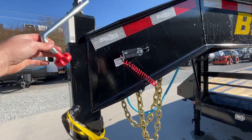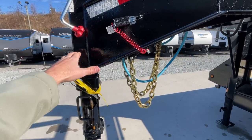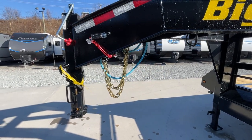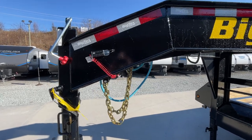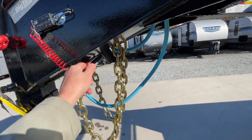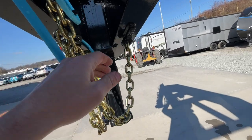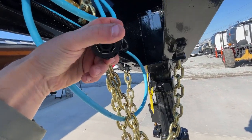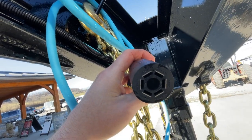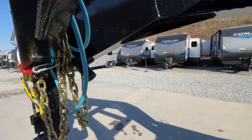The top-line jack is super slick. Unlike most where you loosen a set bolt and do pin adjustments, this has infinite adjustment — you can wind it just like a top-line jack and set it at the exact right placement. Typically on goosenecks you've got holes every four inches, doing four-inch adjustments at a clip, so this is much nicer. It also has the zip breakaway cable — these flex, unlike traditional cables with extra slack. There's a holder inside the neck. It also has the blue cold-weather wiring harness instead of the standard black, which stays flexible down to negative temperatures. They actually color-code the wiring, which you don't typically see in the industry — it tells you which color goes where instead of having to use a test probe.